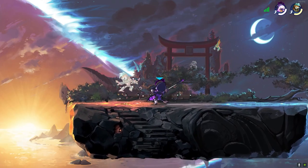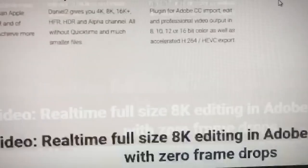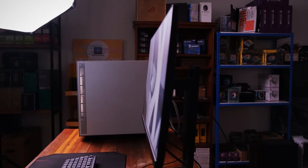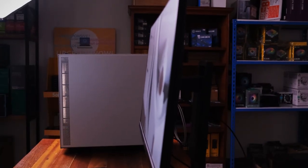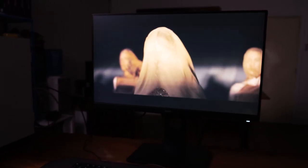Now for the not-so-great things. So far it's looking like a great office monitor, but most of us also use our PC for play, not just work. Gaming with this monitor is a bit of a letdown. The 60Hz refresh rate really doesn't cut it by today's gaming standards. The screen is also noticeably high in latency — even in games like Brawlhalla, Ghost Recon Wildlands, and Risk of Rain 2, the pixel lag is very apparent. Outside of gaming, scrolling through a webpage or Word document, you can see ghosting that's hard to ignore. The viewing angles leave a lot to be desired, though thankfully there's not much light bleed in dark scenes. The overall colors and vibrancy are passable, but you can tweak them to your liking using the OSD.